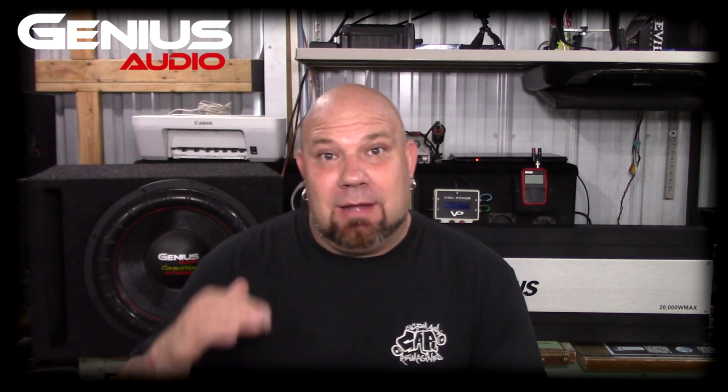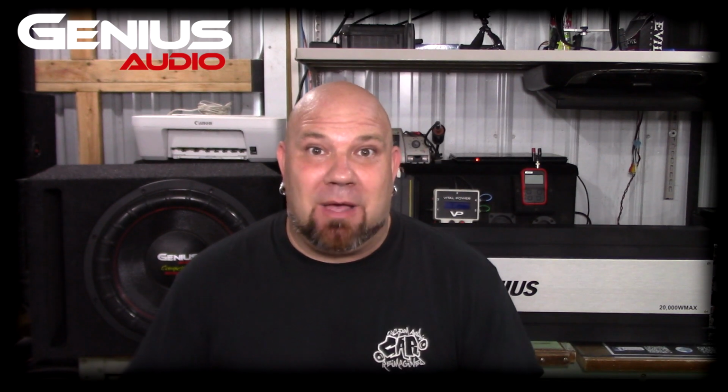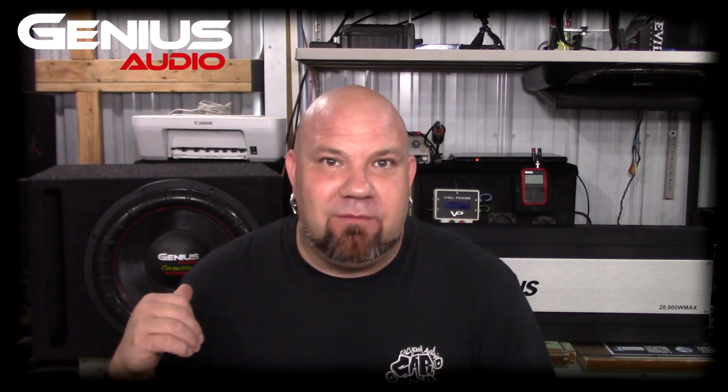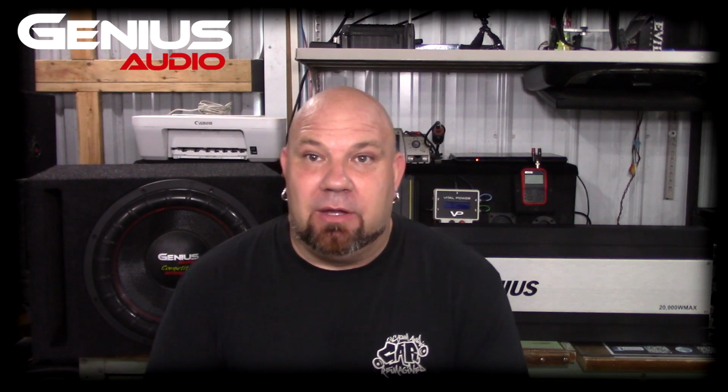But if this thing can hit high 130s or low 140s, if you were to put it in a big old massive DB Drag box, tune it higher to 60 hertz and get a one-note wonder out of it, you know this one sub is going to give you high 140s, low 150s, which is ridiculously loud if you are not used to that kind of output.